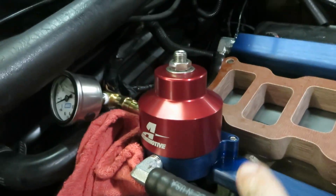I had questions whenever I mounted this stupid thing. It didn't seem like a solid mount to me. It had 1 O-ring and 2 tiny screws that are supposed to hold the fuel pressure, 60 psi, all on top of that rail, without a groove or any kind of a channel. The O-ring just sits flat over a hole on the rails, so it does not work. These rails suck. Do not go buy the BBK rails. It's a horrible design. I've had nothing but problems with them, FYI.